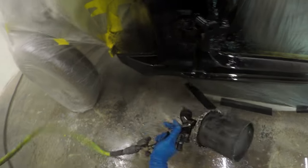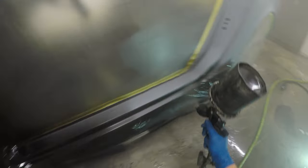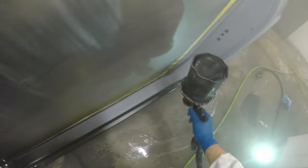When you're spraying a reduced epoxy primer, it sprays like base coat should. So it gives you the ability to go ahead and fine tune your gun settings before you start spraying that expensive base coat paint. The base coat that we're spraying is the Tamco Datsun Black Pearl Paint Coat 638. That runs $400 a gallon. And the epoxy primer is significantly cheaper than that.